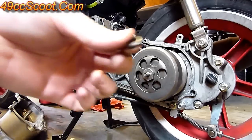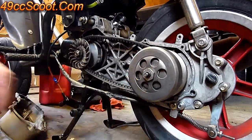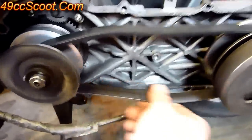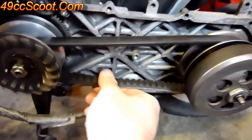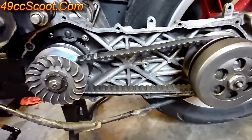The last thing is this little O-ring — make sure you slip that back over the shaft. I like to spin the variator and get the belt to seat the way it should. This is easier with the spark plug out so it'll turn over freely, but you can do it with the spark plug in still, or you can wait and when you start the engine it'll do the same thing on its own.